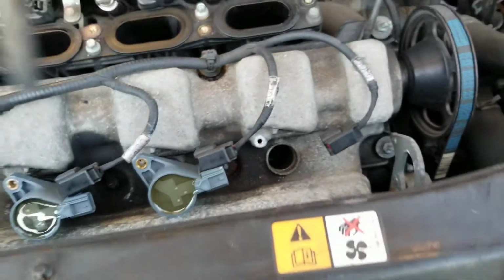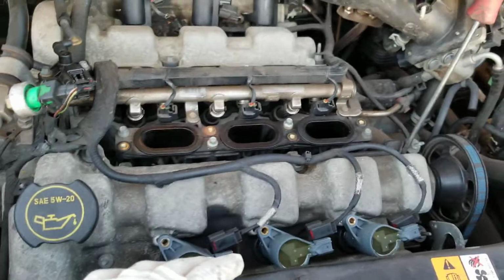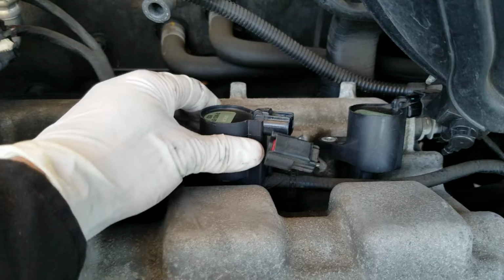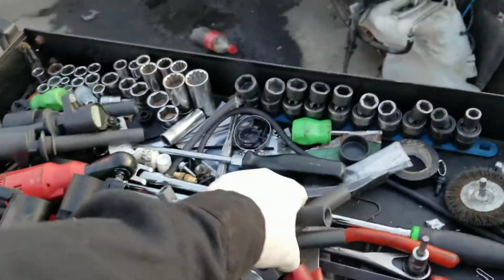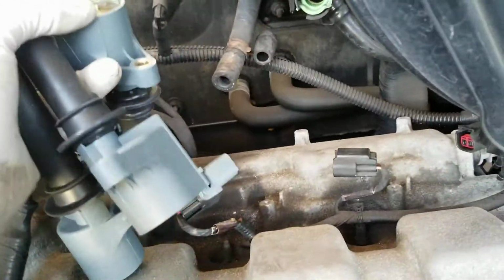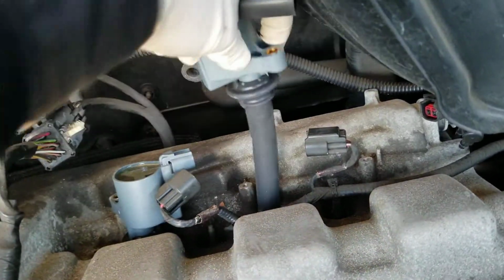If you have any misfire, starting with the P0300, as a multiple misfire. P0301 is cylinder 1, P0302 cylinder 2, P0303 cylinder 3. So if you have any of those codes, just look into it. Check your spark plug, check your coil, make sure you have spark. Also, once the spark plug is removed, make sure you have compression. All those little details matter.